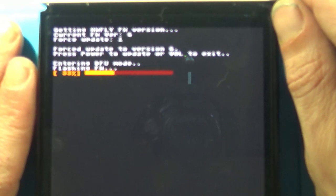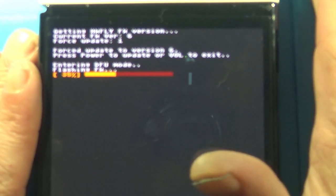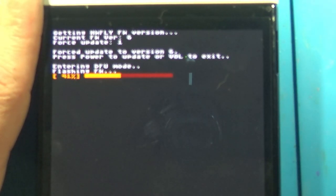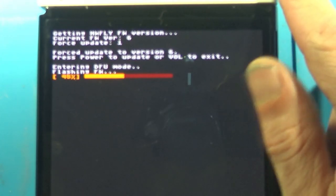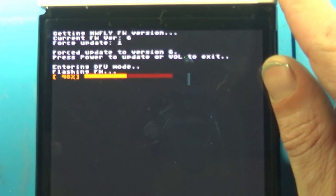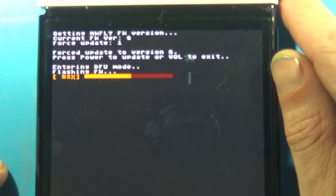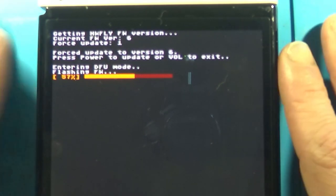Just get on 6.2 before you update your firmware, and you won't have any problems. But that's pretty much all there is to it. If you're on 6.0.0 or earlier of the custom firmware for the mod chip, the custom version build of Spacecraft, then you're going to run into an issue when you update the console. So just flash like this, and you're good to go. Once all this is done, power off the console, boot it back up, update your Switch, and you'll be perfectly fine.